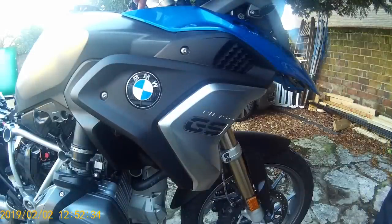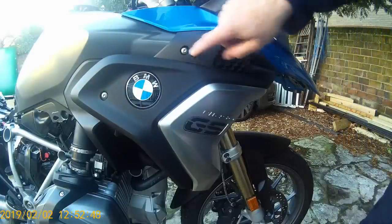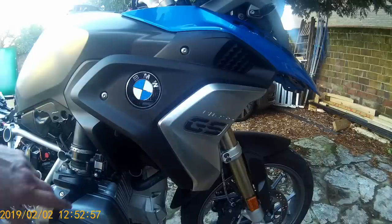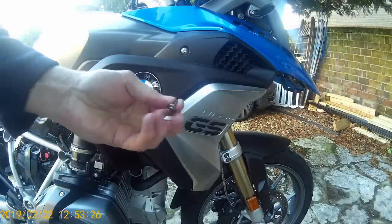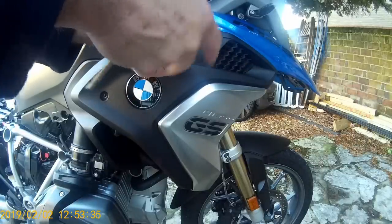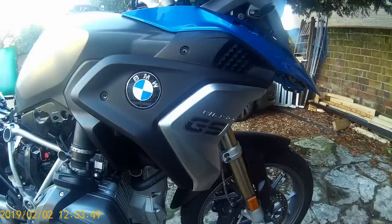Before removing the beak, there's a screw here for it and one underneath it. There's also a screw down under the side fairing. The side fairing is held by two Torx 20 screws at the top and a couple holding the fairing to the radiator cover, plus a push pin deep inside — which is a bit awkward to remove without breaking. I'll show you that in detail. This Torx 20 has a positioning collar and is short; put screws in expanded polystyrene and mark their position — upper, front, right fairing, etc.